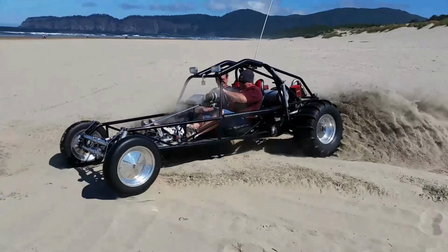Alright, got it off. Well, I didn't know about that bolt there, but I see that just provides support down to the floor. So, just kind of want to look at the master cylinder here. Compare it to the one I have. Oh yeah, you can see it's a much larger body. Yeah, it looks like it's going to work just fine. So I think I'll pull this apart. Got a little work to do. It's pretty ugly, so make it look nice, bolt this on and go with it.